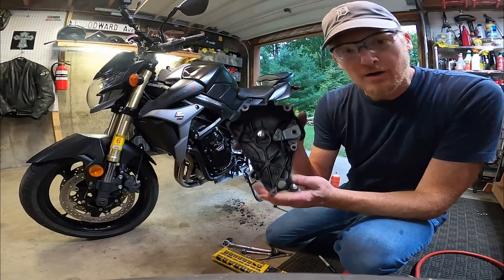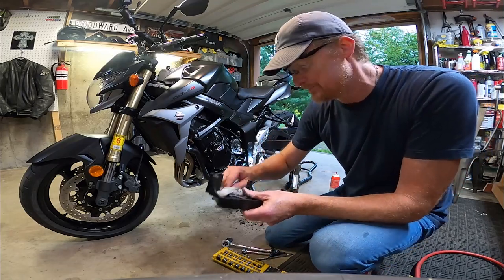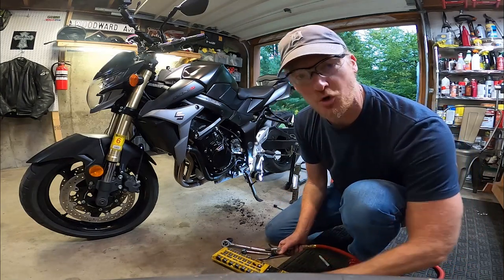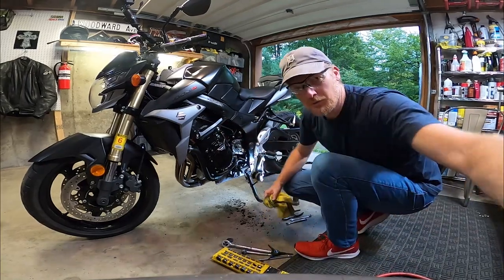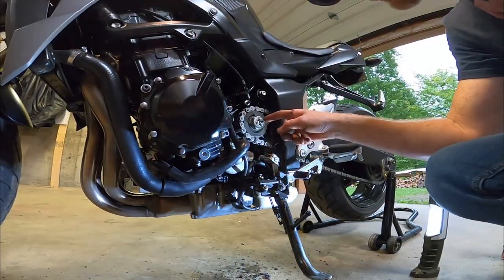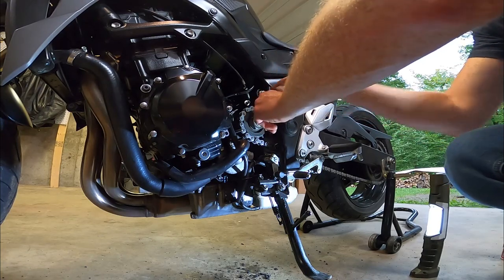It's not perfect, but it's a lot cleaner than it was. When I move this thing, it doesn't sound gritty anymore — successful clean. I just used a nylon brush, dish soap, and hot water. Now I'm going to remove the sprocket. First gear. So this is the speed sensor rotor — this little tiny doodad here. We're going to remove that.